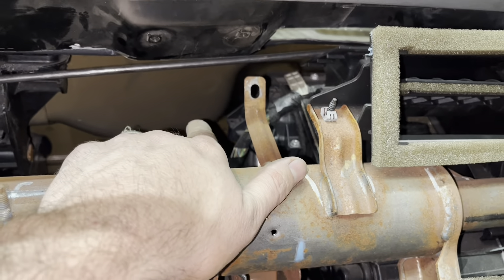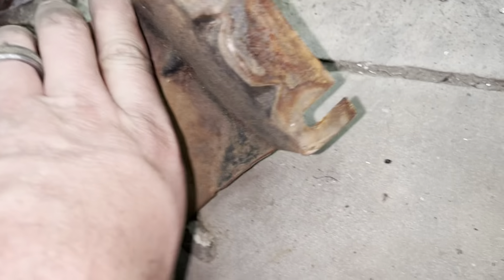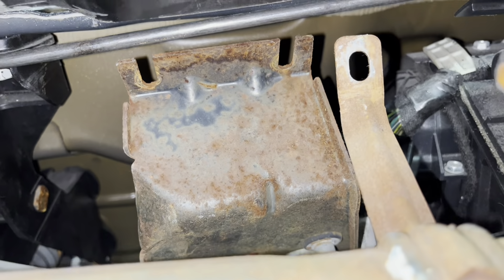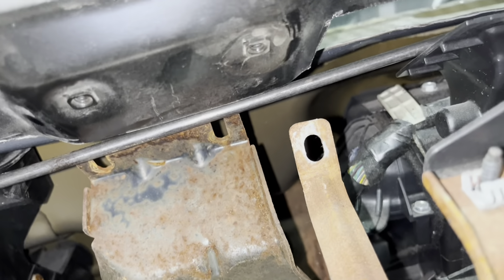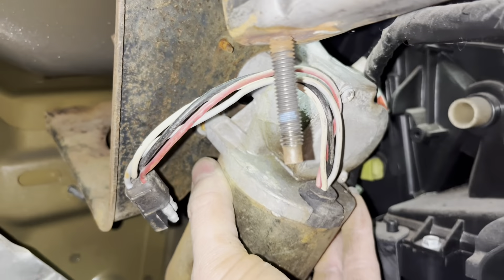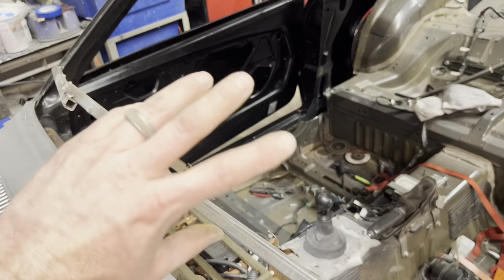Let me get my arm back in here. With that right there it's supposed to go around a little bracket, and then I can make this go up, bend down and over to exactly where it needs to go — so that's not an issue anymore. You can see right there the two parts that mount to the top. Looking here you can see the factory 67 Mustang wiper motor — it mounts right up there and it's not contacting anything. It won't go up because of that bracket, so I can cut that piece off and make it mount to the bottom section of the firewall. I can use the factory 67 Mustang wiper motor and it will be way up under the dash, out of the way of everything, and if it ever needs to be replaced someone can easily get underneath the dash and replace it.